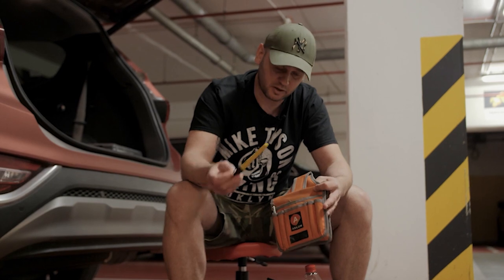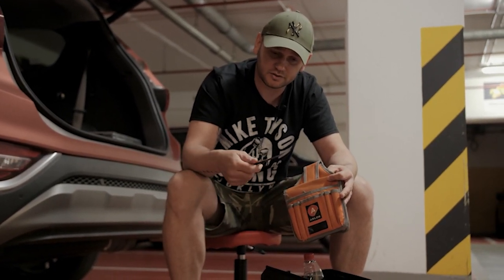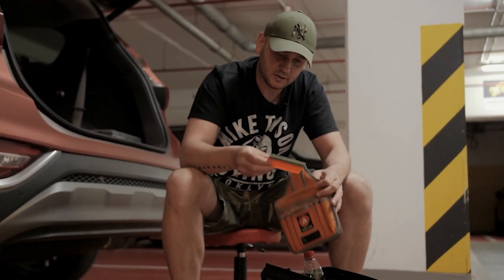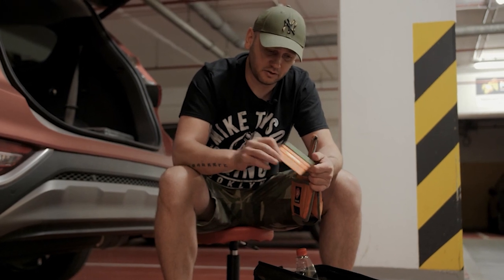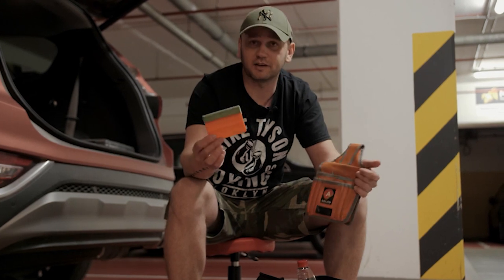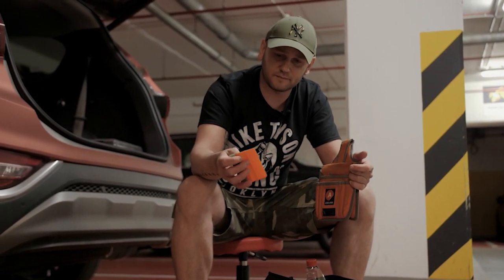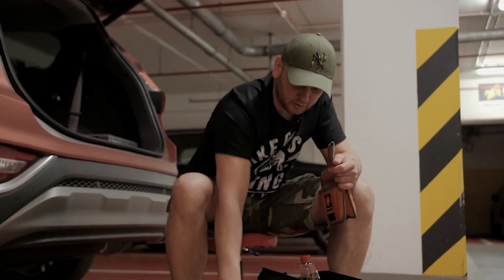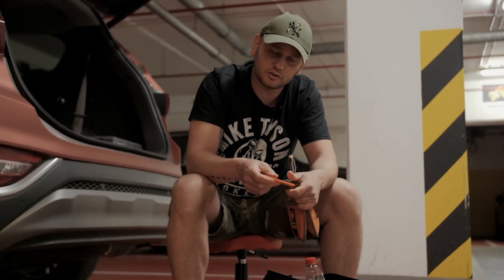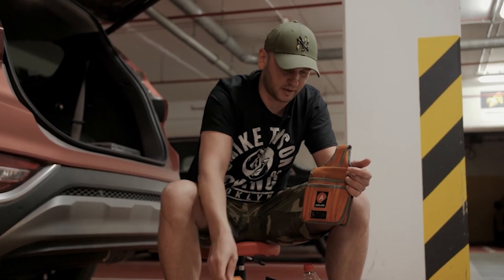I have a marker, a knife with blades — 30 degrees, of course, not to cut the paint. I have a squeegee; my favorite one is the orange one from Arlon. I approved it for Europe, so of course I like it. But seriously, I like it because it's soft enough to go around curves, but at the same time it's really stiff. That allows me to use proper techniques on deep tunnels like in a Renault Master and other vans with sharp angles. I also have triangles — you can see they are really used, because that's a very popular tool. I love to use them when dropping film under the rubber around windows.